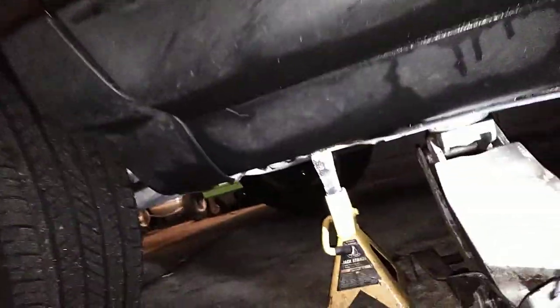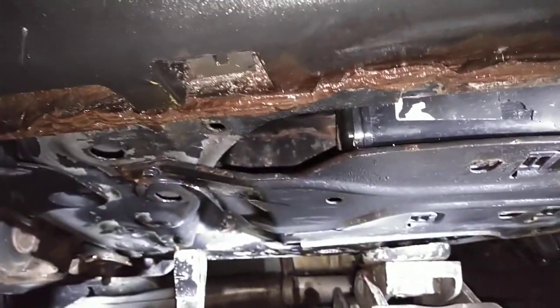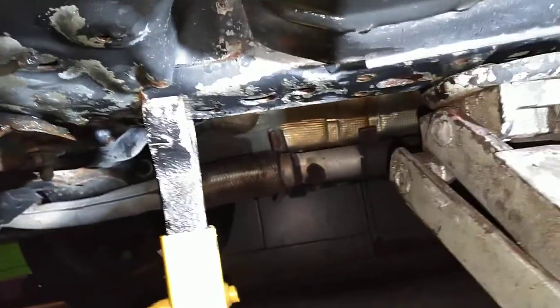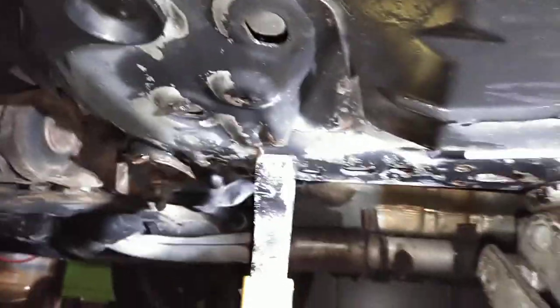I'm in this little garage, but basically you take a jack and a jack stand — always use jack stands. I never use my pinch welds because they're just rusty. This is a Wisconsin vehicle, very rusty underneath. I go right to the frame, jack up on the frame, and put the jack stand right there on the subframe — a really good solid piece. This way you're safe.